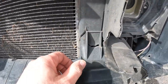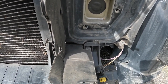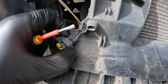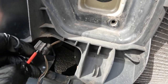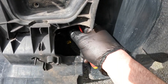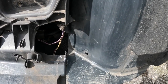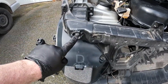And this now lifts off. I'm now starting to see a bit more damage, which is concerning — I can see it's fractured here and here. Let's see how bad it is when the whole thing is right off the car. Next, we can remove this little air duct — it's just plastic fitting into some slots, very easy to remove. This redundant fog light wiring needs to be unslotted and this clip removed. There is a small clip here that secures the wheel arch liner to the front panel — that piece is missing on this side, so it's just flapping about in the breeze.